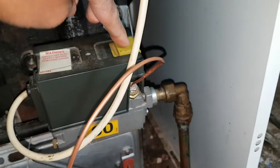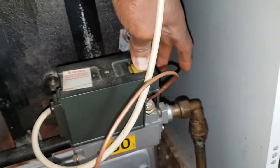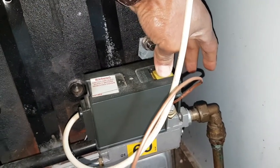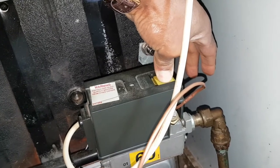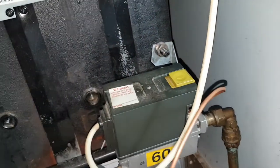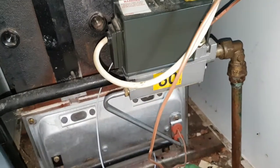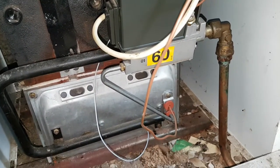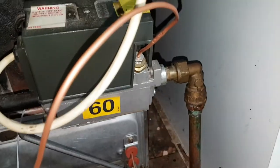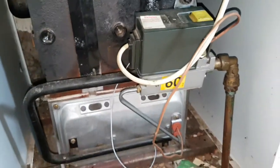What you do is press your finger down and then light the igniter. The pilot light stays on — should stay on. You keep your finger down for 30 seconds; it gives it time to create the voltage. Once the voltage is created, when you let go, the voltage keeps the valve open and lets the gas out to keep the pilot light going. So if the pilot light goes off, no voltage — it shuts off the solenoid. That's called a flame failure device.